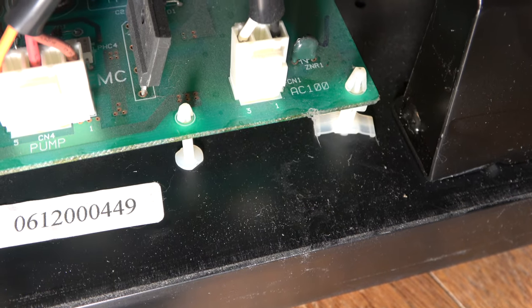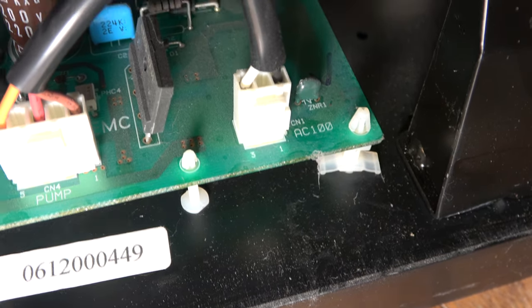It's become apparent that the reason we have an AC connector there, and we then have a rectifier, and lots of capacitors, including some high voltage ones, it's obvious that part of the power supply is on the main board here. So I've had some fairly inconclusive results trying to measure voltages on here, which is from the power supply. Fairly sure that's AC, so that's not going to tell us terribly much.